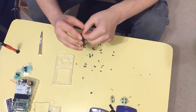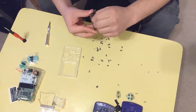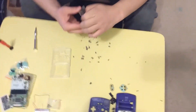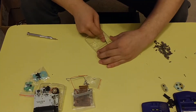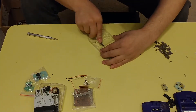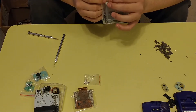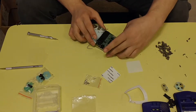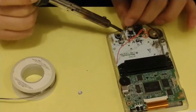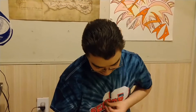This is how you separate the noobs from the pros at doing this stuff, because seeing other people where they just rip it off in one piece — as you can see, I had troubles doing mine. After that, just put a few notches in the shell for the wires to be able to route through, place the frontlight in front of the LCD, put the motherboard on top, solder the light to the board, screw everything back together, and voila — frontlight mod.